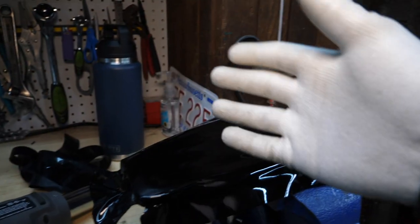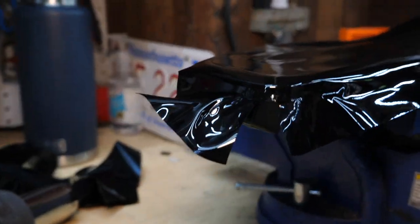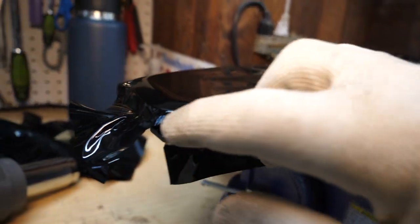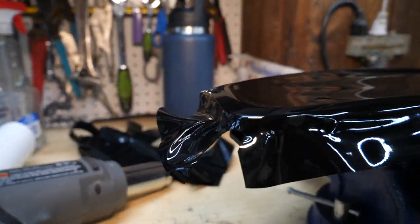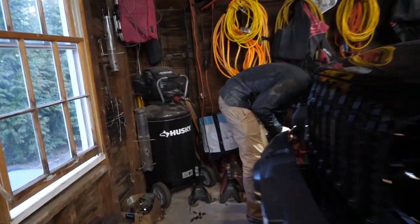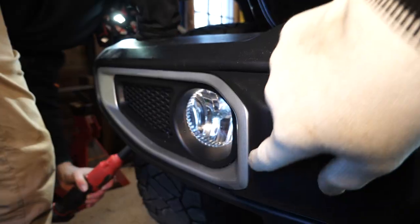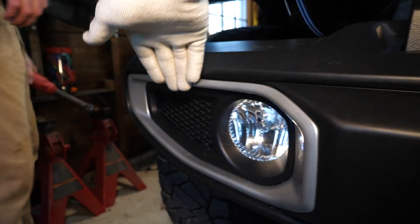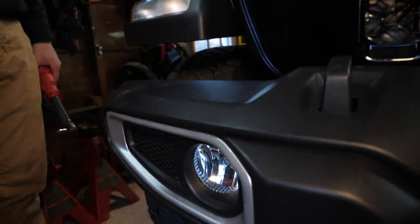All right, so wrapping 2D material around something 3D like this and around hard corners is definitely difficult. It is doable, as you can see here, but difficult, and it's hard to get it flawless. But I just went over to the car here. Sam's still pulling off this side. And if you look here, this edge is completely recessed. So we can actually hide a rough edge around the outside as long as it goes past this front edge right here.